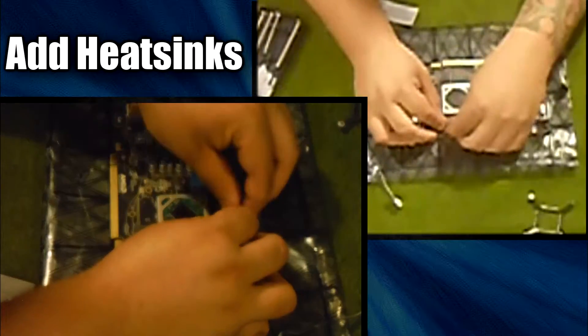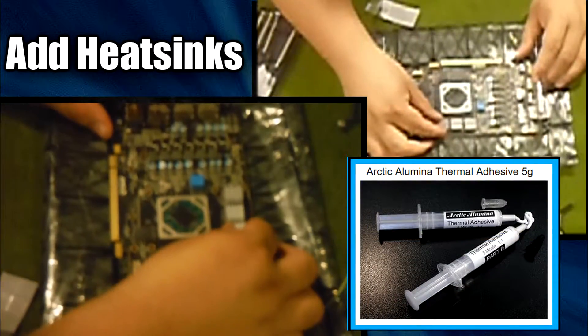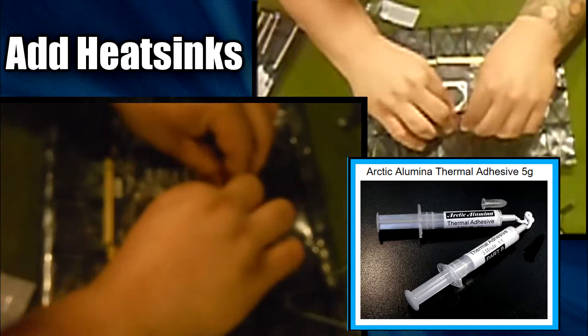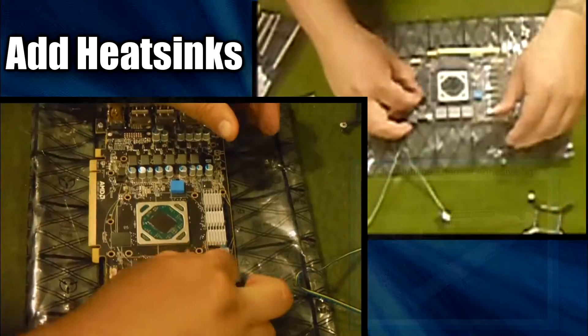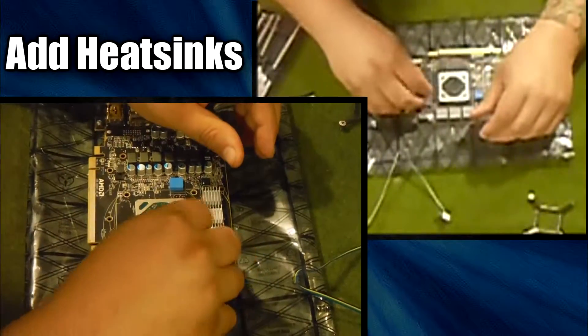There are a couple of different ways to attach heat sinks: you can use a thermal paste that acts like a glue — kind of like an epoxy — or you can use the thermal pads that came with the kit. The thermal pads that come with it don't hold as well as you'd like, but I gave them a test and I could pick up the whole board with the heat sinks attached, so they did good enough. Some of them I did have to use the epoxy on, though. I'll put the picture and link below for all these extra parts.